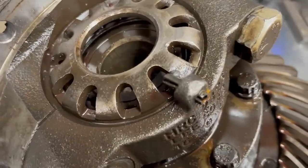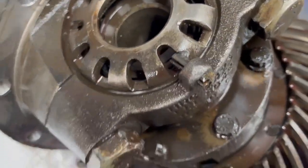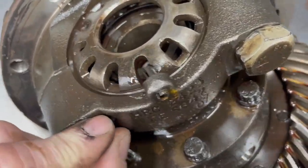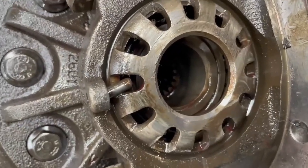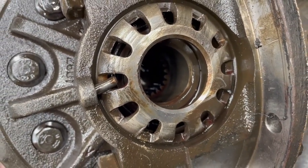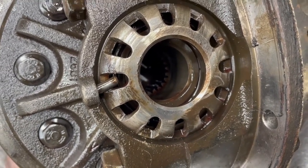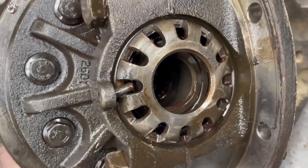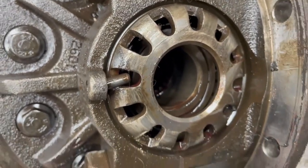Now we'll start with the silly little pins that are in here. That has been bent very hard against the adjuster ring, and is bent the opposite side. That means the adjuster ring has moved, which has unwound itself, which means it changes the backlash — which probably explains the clunking noise that the customer had. This is purely a cost cutting exercise.